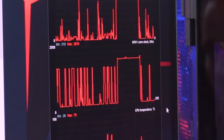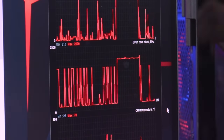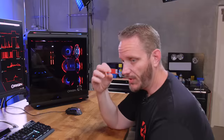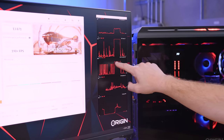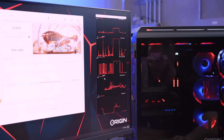There's a little frequency peak during the top-down ship hangar shot — that part of the test is designed to let the clock run away and potentially crash your card. If you make it through there, you're stable. At the end of the test, frequency shoots up dramatically. These two parts of the test are what we worry about when overclocking.